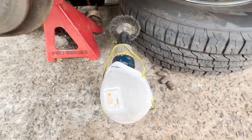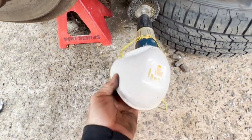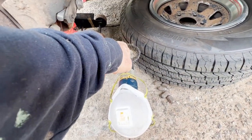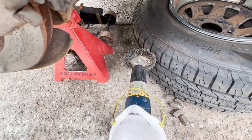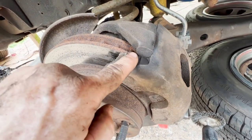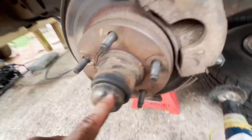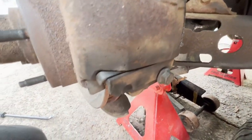One of the first steps prior to disassembly is to get your wire wheel and drill. Use a dust mask and safety glasses — these little whiskers fly out and just like to go to eyeballs. Clean up anything that's going to be reused or any surfaces. These calipers are going to be replaced, but they're going to slide in here, so anything you can clean off prior to disassembly will make the initial disassembly so much easier.